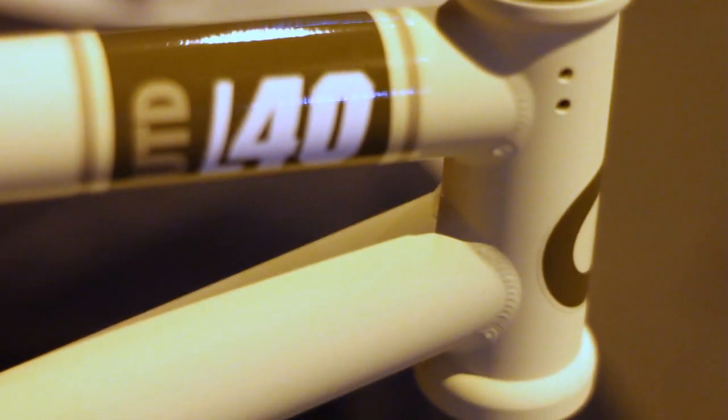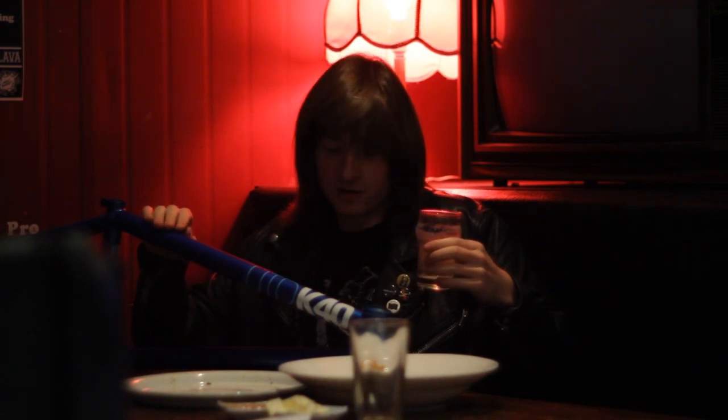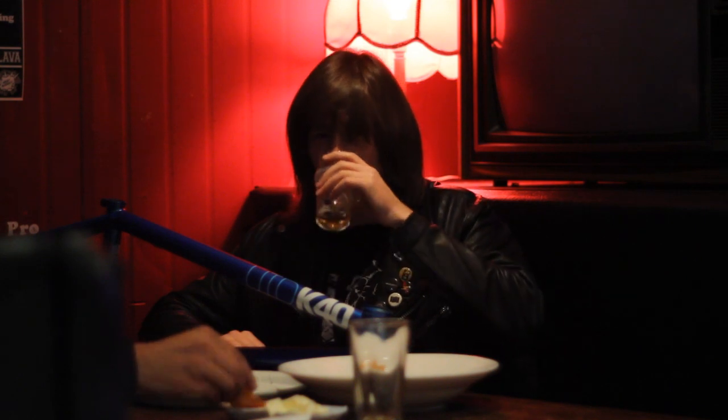Here's the United K40. We've also got the L40s — K and L stand for Kai and Leo Forte. The K40 in royal blue is obviously the Kai Forte signature, and the L40s are Leo's. We also have these in black in 21 and 21.3-inch top tubes, and the black frames come with graphics for both Kai and Leo so you can choose which sibling you love most. These frames have a 74.5-degree head tube angle, 71 on the seat tube, mid bottom bracket, and a tapered seat tube that saves a little weight without sacrificing much strength. Geometry is pretty similar to last year's with a 13.75-inch back end.